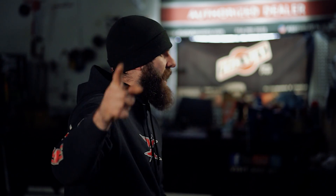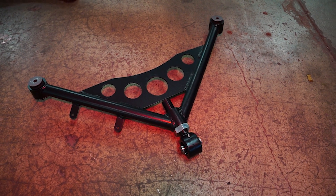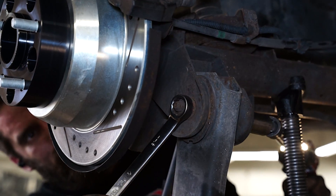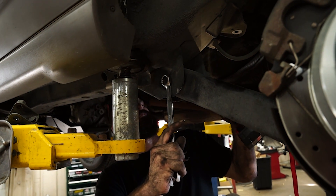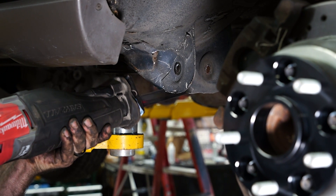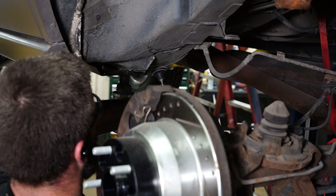You will notice you do not have an upper control arm — this is where the goofy stealth bomber rear link comes in. Once the lower control arms are removed from the vehicle, you're going to be cutting off your mounts just like the fronts. It's going to take a while if you don't have a plasma cutter — I cannot stress this enough. This part of the process was a long, tedious one.